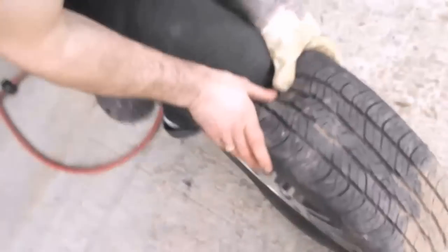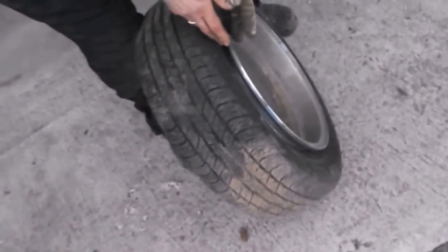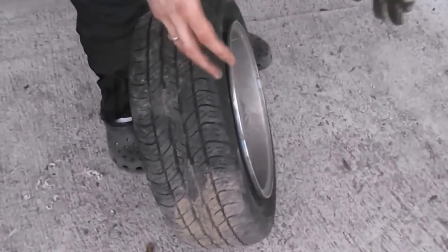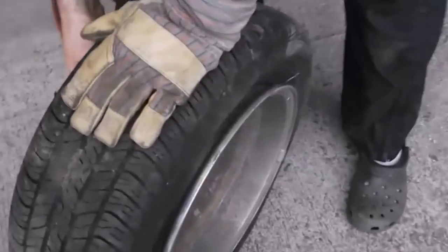I'm gonna be putting the air compressor hose on and adding air. If it really won't seat, I'll drive my knee into it a few times as the air is going in — just that alone may be enough to cause the rim to come in contact with the rubber. As soon as it contacts and seals up, the tire's gonna pop. If that doesn't work, I've actually tried dropping the tire. This one may just seat easy and snap right into place, but if it doesn't, that's what I'm gonna do.